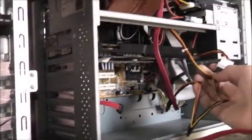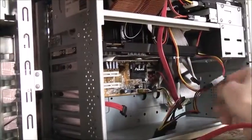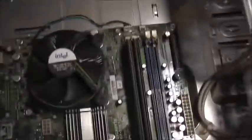It's got the right connector. I think this power supply does it. Might, hang on a minute. I think it does. I have to do some checks. That connector on that power supply. I think it has two of these little connectors to power the motherboard. Yeah, it does. It has two, so I can power a dual CPU board. That's a dual core capable ATX power supply, so that will fit straight in there. I'm right, and it has Molex. I'm going to have to borrow that, so it's got that to go in there. Perfect. I got everything I need. No adapters needed. Everything's just ready to go. Beautiful.